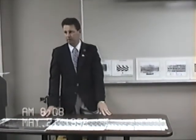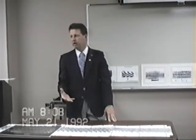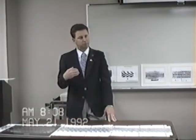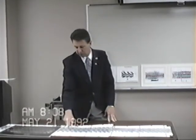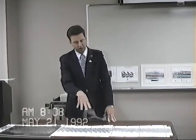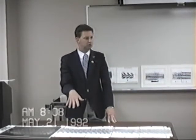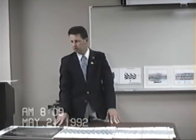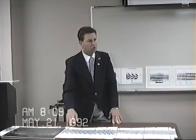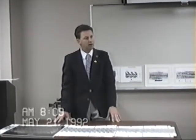Explain a little bit about tire design. Basically, I wouldn't get too involved in it, but I'd explain that manufacturers have a noise treatment built into the tread design. All the elements that you can see on this test impression are not the same size. They're changing in size, and they're in a certain sequence, which has been set by the engineers who designed that tread. And the reason that they change the size of these is to quiet the tire down. If they're all the same size, the tire would be very noisy, so they arrange them in a certain order to quiet the tire down.